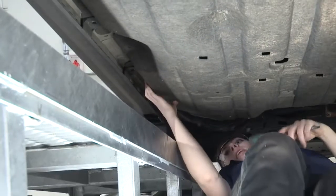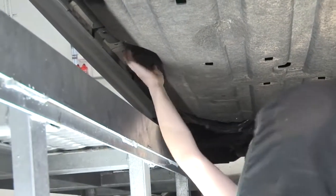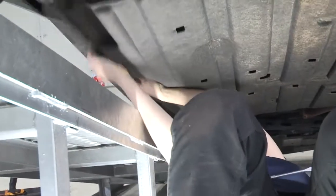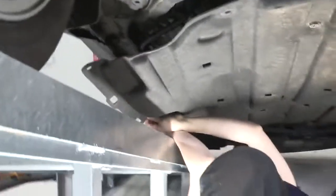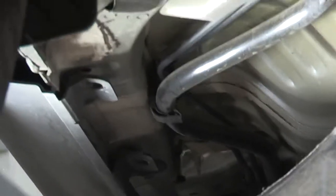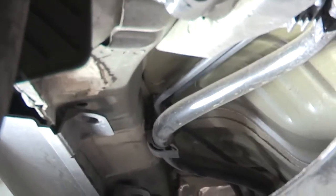Now we've got most of the fasteners off of this cover removed, and we can get on the side of it, pull it down past the side skirt, and take a look at what's going on. Now that we can pull this cover down a little bit, we can see our brake lines right here and we can see they go all the way up to the front — that's going to give us a nice, clear, safe and dry path up to our battery. So we're going to run our power wire along those lines and secure it right along the line as we work towards the front.